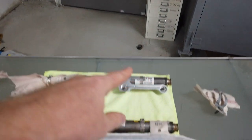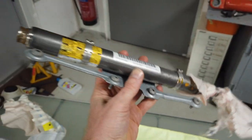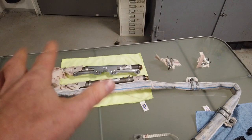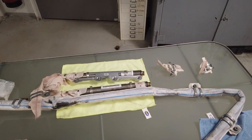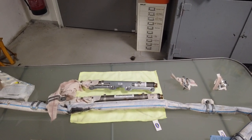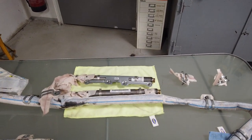...two wires joined together with a resistor across them to make it think that the airbag had been replaced and was present. This is an explosive charge - you put some voltage in, it fires off the explosive and inflates the airbag. We now have to replace the airbag and find a connector. The manual says you shouldn't repair an airbag loom, but we'll probably solder a connector on - I think we'll be okay with that.